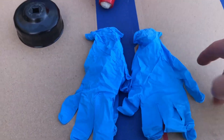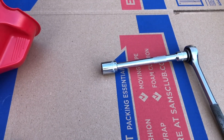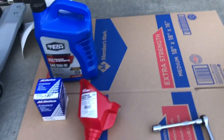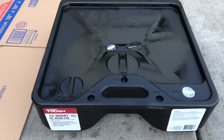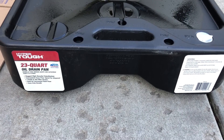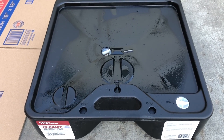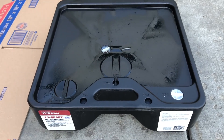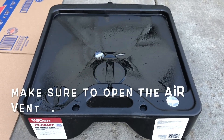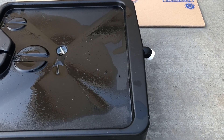I love these blue nitrile gloves — they keep your hands fairly clean. We also have a socket with an extension and a 15mm to remove the drain plug. I like to use cardboard just around where we're draining the oil to keep some of the splatters contained. Today we're also going to be using a 23-quart oil drain pan. I've got about 12.5 quarts in there from other oil changes. It keeps things really clean — this has been a great way to contain the used oil. You take out the two drain plugs and it dumps really nicely.